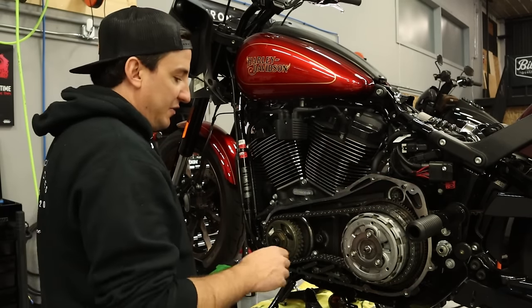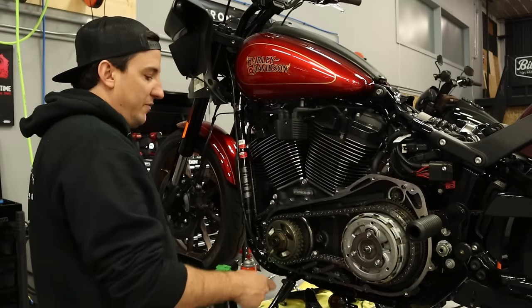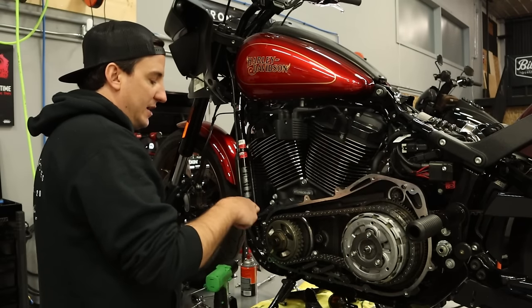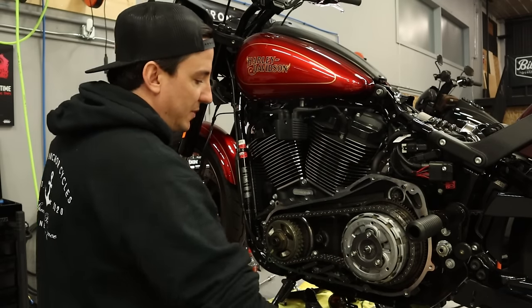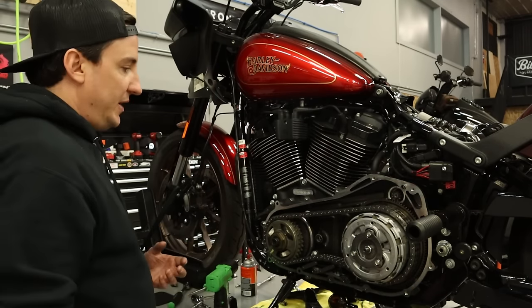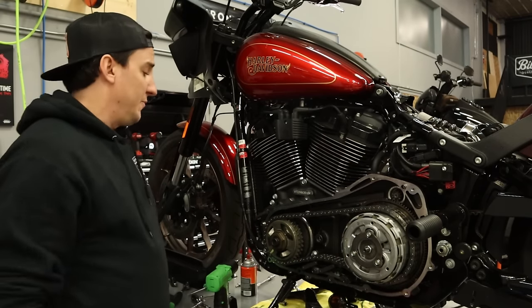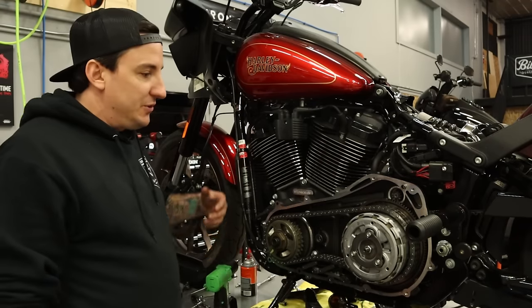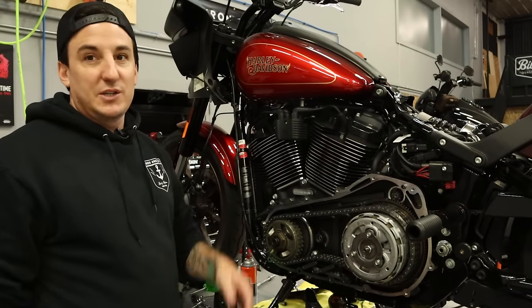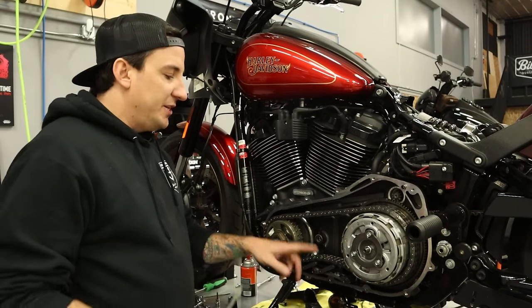First thing I'm gonna do is take out the primary chain tensioner. Then we're gonna remove the bolt for the compensator, and we're gonna start to get the clutch side disassembled as well. And then we're gonna pull all of this out as an assembly. Then we've got some bolts in the back here that have to come off, and then the starter. So nothing too complicated. Just gotta follow the procedures and take out a whole bunch of hardware and we'll get this cover off.